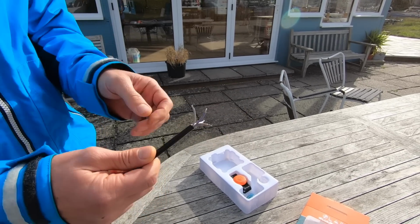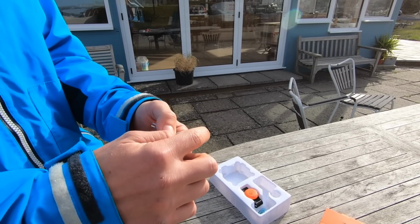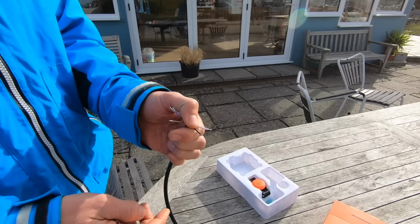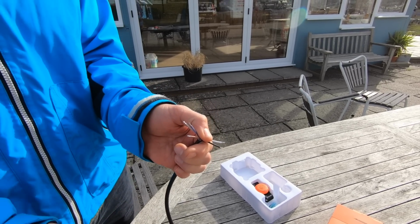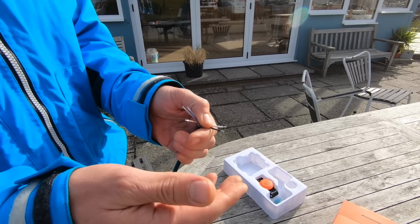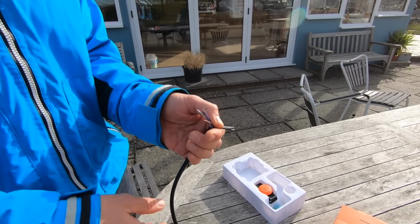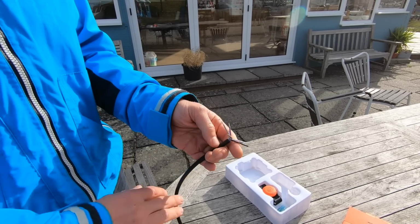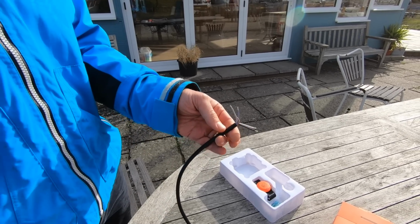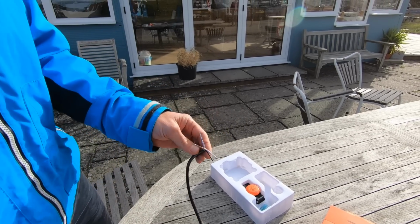And then you want to connect up your power cords as well. Simply connect it up ideally to an existing fuse box, for example, which makes it easy. If you don't have that, you just need to connect it up to a power source post the battery isolator. Okay. So when you isolate the battery, then you're disconnecting power the whole time. It's very low power consumption. Okay. Anyway, very, very minimal power consumption.